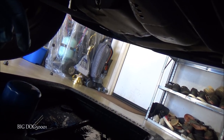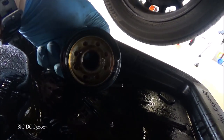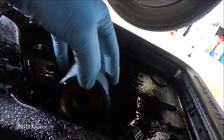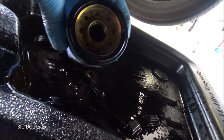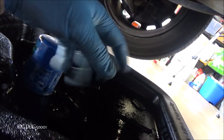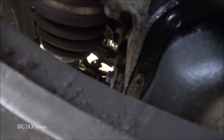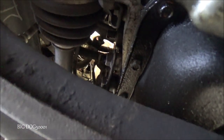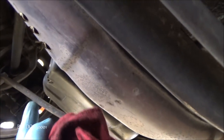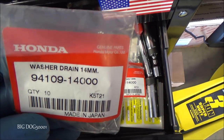There's the rest of the oil — yeah, that's warm. Now we'll just let that drain a little bit more and clean it up. One important thing: we want to make sure that rubber gasket — right here on the oil filter — is still on the filter. Usually they stay on these Honda oil filters, but you've got to make sure. This one's on there, so we're good. We don't want to double-gasket. Now I'm just going to clean up right around where the oil filter mounts.